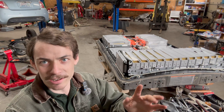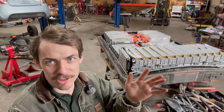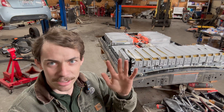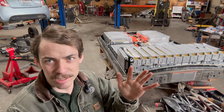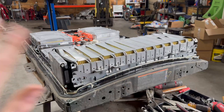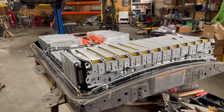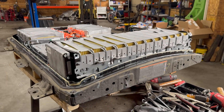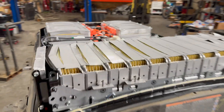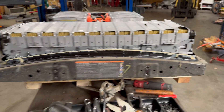What we're here to look at today is this Nissan Leaf battery, which has got some pretty major failure modes. I'll show you guys around it, give you a little bit of a deep dive, and we'll take a look at what exactly is going on. This is a battery pack out of a 2018 Nissan Leaf — actually that white one up there on the lift. This is a 40 kilowatt hour battery, and as you can see, we've got some very significant cell swelling going on here within a bunch of the modules in the pack.